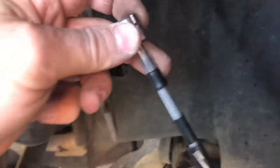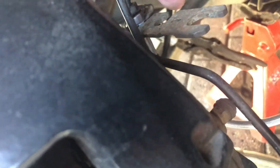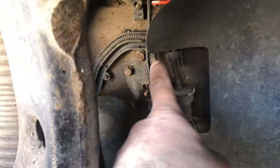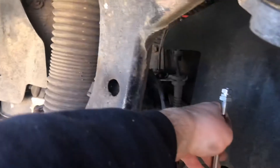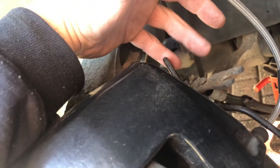The new pipe is already fitted to the caliper holder and the steel pipe. Now we're gonna place it back with the ABS cable and the brake pad sensor. But before this I'm gonna fit that over here on the top of the steel pipe, and that's gonna be almost finished from that side — it wasn't difficult this time. The trick with that steel pipe to not break it — it's quite easy and it's at least one, one and a half hour job, shouldn't be longer.